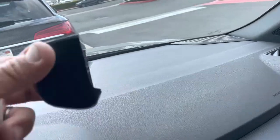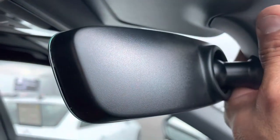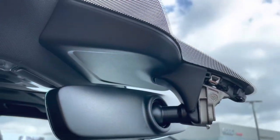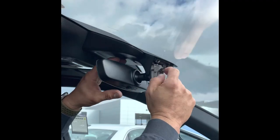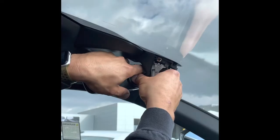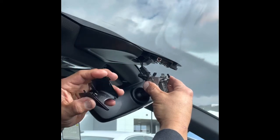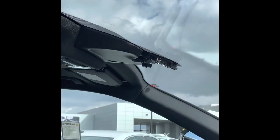And this piece comes right off with no damage. Now we're going to need to remove this junction piece here, but it's locked in from this piece and I'll show you how to remove that. Now that we've got the cap off, you can simply come over here — these mirrors are designed to break off, so you're just going to gently rock this towards you. The mirror comes off. You can remove this cap with no damage, and disconnect this. Now the mirror is disassembled.